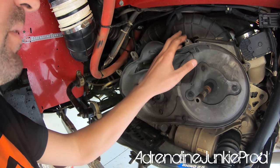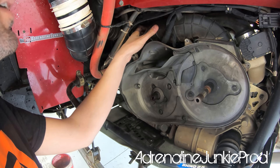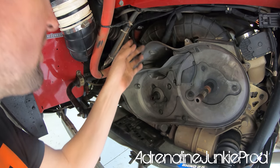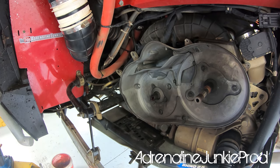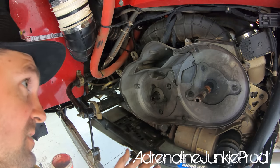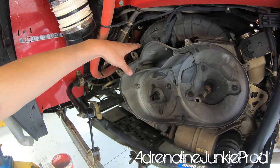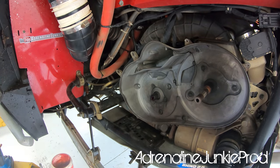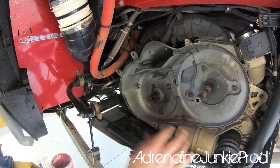This is also a good time to mention I really want to do a CVT exhaust snorkel on this machine to extend that CVT exhaust outlet higher up. It's a real weakness — water splashes up in there, wets the belt, and your belt slips. You can only go so deep in the Razer Turbo before water starts to pool back in through the top of the CVT, and the clutches and seals are not supposed to get wet or contaminated.